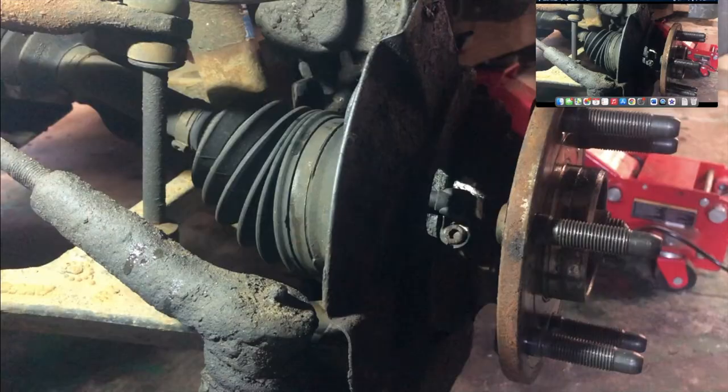Just a little intermission here. When I saw this crack while working in the garage, I got excited and started taking stuff apart, and I forgot to explain the wheel speed sensor. This black box here is the sensor that goes down into the actual bearing, held on by an Allen head. There's a little metal bar on the end of the sensor that sits against a race inside the bearing — as that race goes around it generates AC current, which is transmitted up the sensor into the truck's computer. That signal tells the truck that the ABS is functioning properly, among other things.